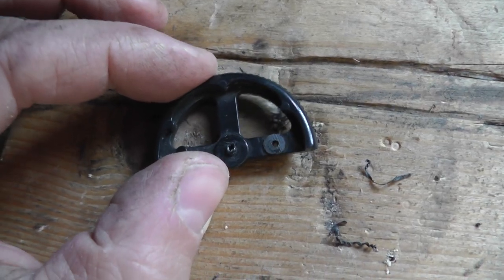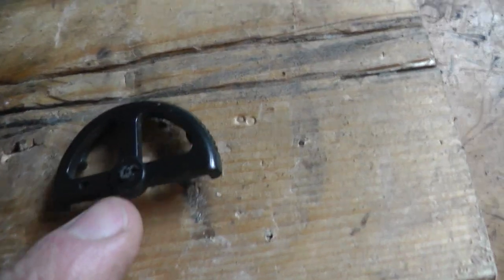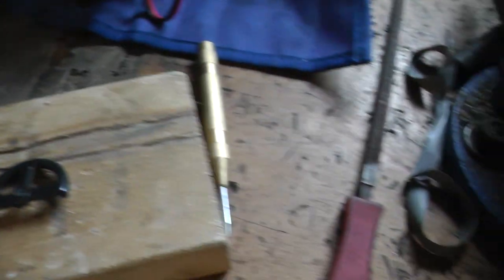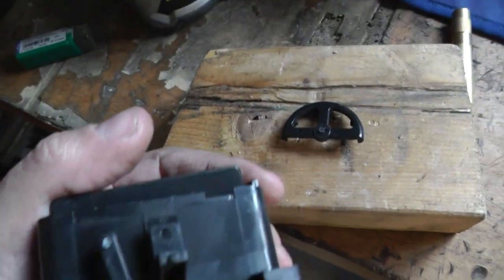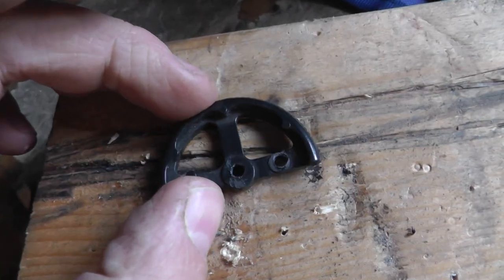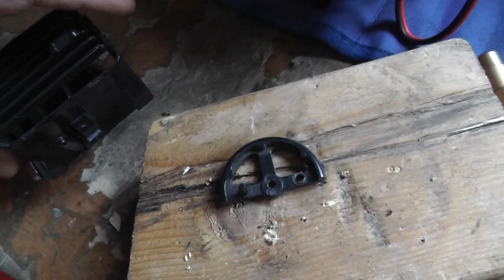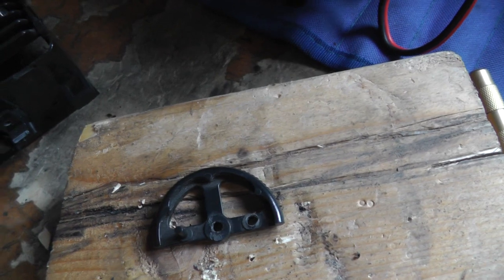So that's what I have — two little holes. Then I go to 2mm. I'm just going to sand off that nub there. My next stage is a 3mm drill bit, which will get me an M3 threaded screw through all of this. It's about 2.5mm at the moment so I'll just bore that out to 3mm. The holes are bored to 3mm — that was very tight because the plastic is so close.